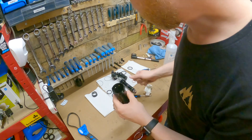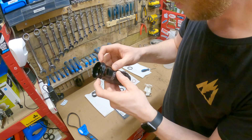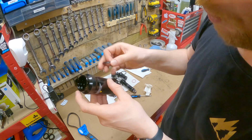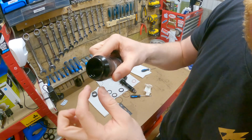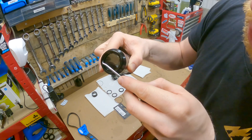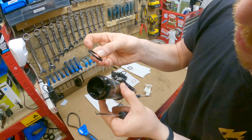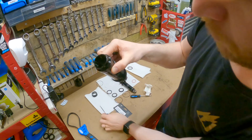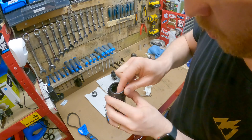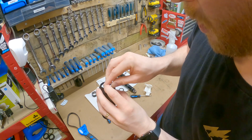I'm going to fit the new seals in the order I took them off. The first thing I'm going to put on is this new O-ring which fits at the bottom of the thread - we'll apply some grease to all of these in just a moment. That goes on there and sits at the bottom really nicely. Now I'm going to put in this new rubber seal - there are two little lips on the inside. There's the first little ridge where the main dust seal sits, and then underneath there's another ridge where this seal sits, and then the white split ring fits on top of that. The split ring closes in on itself so I can get it in there.